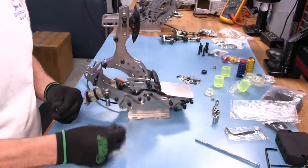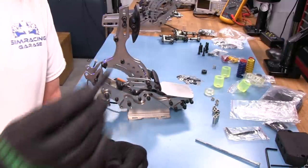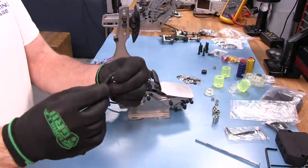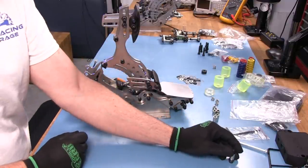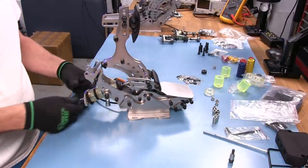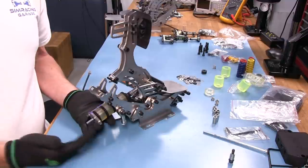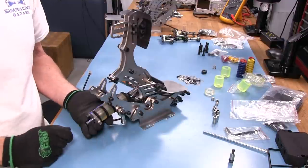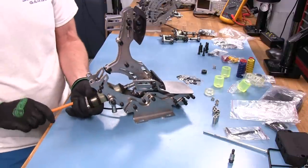The bolt itself has a washer on it on the other end, which doesn't affect the preload at all, obviously, because it's pushing on the other side. I want to put those back together like that. Set this aside. And then I'm going to take the other one off. But when I do that, I'm going to have to hold up the back plate here, or all this is going to want to come rolling off of here. And remember, there's a bunch of washers in there, so that would not be a very good situation. It'd be a big old mess.